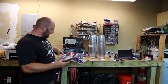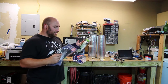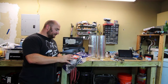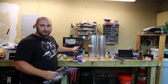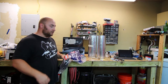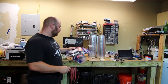Next we have these adapter kits — I bought two of them because it was cheaper that way. They come with wire adapters that fit the standard GM body plugs and have spade terminals on the other side to fit most speakers. They also include two grill kits that adapt the factory door size for the front doors to accept six and a half inch speakers. For the rear half doors, nobody currently makes a bolt-in adapter for six and a half or six and three-quarter speakers, so we'll have to trim and work around that.